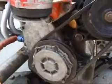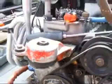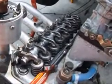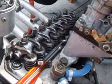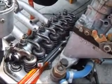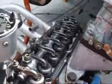What I've done is set the engine at top dead center. That will set up the valve arrangement so that I can adjust these quite easily. Once I get half of the engine adjusted, I'll turn the crankshaft 360 degrees and adjust the other half. So let's take a look here and see what we've got.